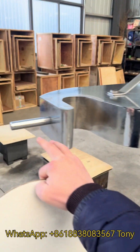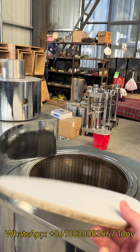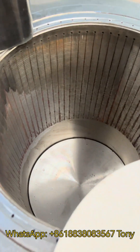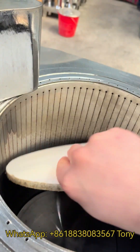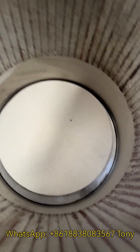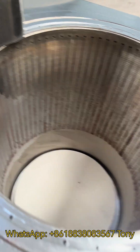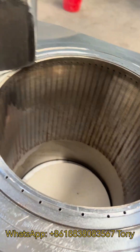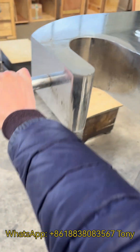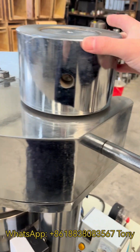Then you can open the power. Before you press the machine, you need to open this cap. We offer you several plates — take two plates, put one here, and then pour in the oil seeds. Then put another plate on top of the oil seeds, then close this cap and fasten this nut.